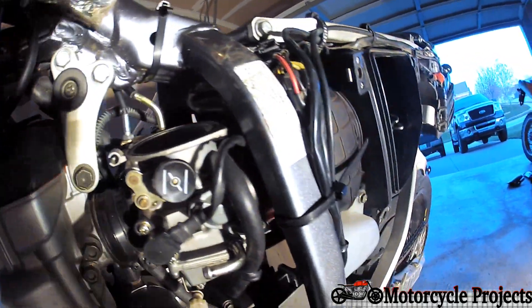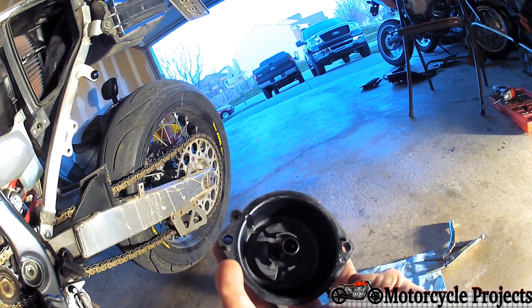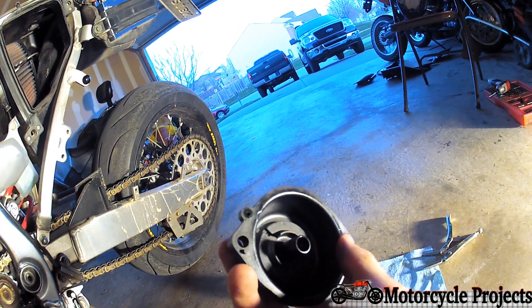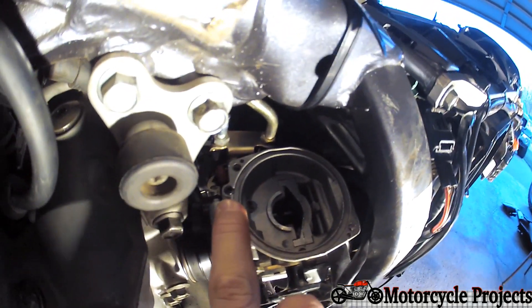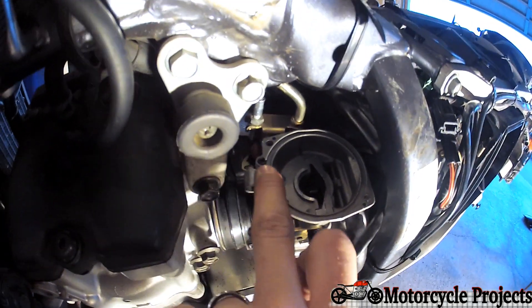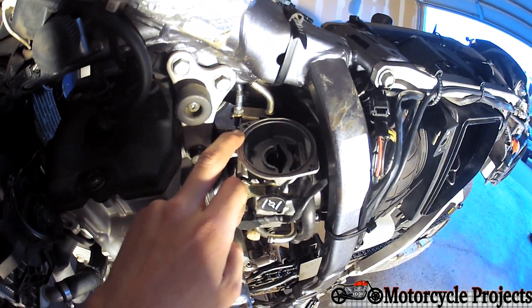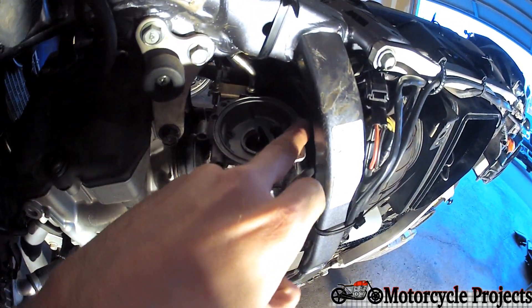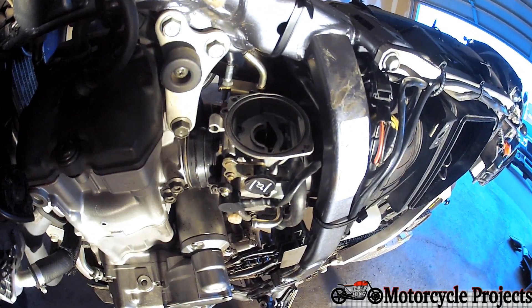So we're going to adjust this needle, put the diaphragm back in, and put the cover on top. Make sure to orient that — see this little nub here? There are a couple of little pins sticking up and there's this hole, which is an air return hole. There's an O-ring that should be there; make sure it's not missing. Be very careful not to misalign or move that out of place. If it's been installed for a while, it'll probably stay in pretty well. Make sure the diaphragm sits neatly into the ridges, then put the cap back on and secure it.